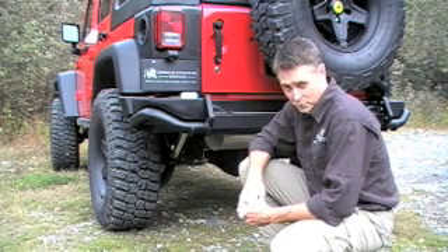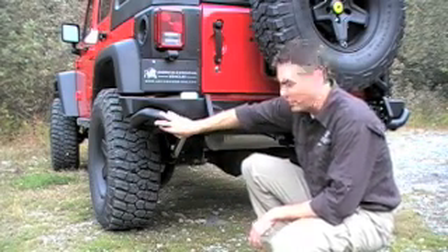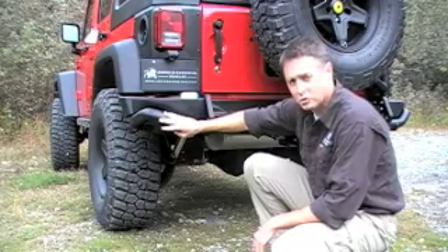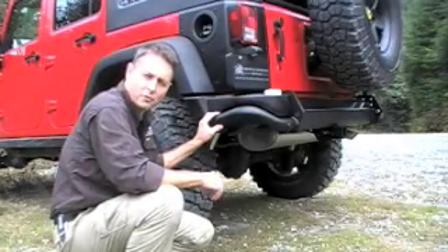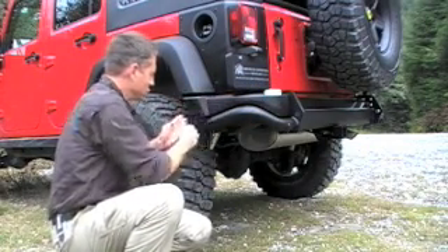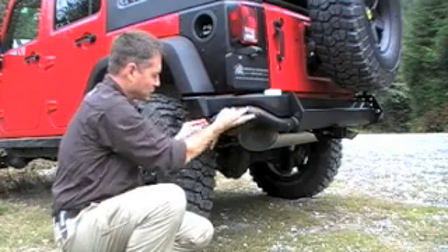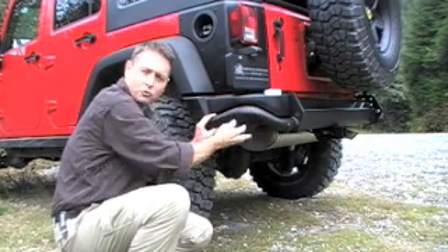Obviously, one of the most important jobs of any bumper is to protect the vehicle. This is particularly critical with four-wheel drive vehicles, where impacts of rocks can often come up right from beneath and cause all kinds of damage to sheet metal. To build the right amount of protection, AEV has used very heavy materials in all the right areas. A lot of aftermarket bumpers attach to the chassis, come out around the corner of the vehicle, and terminate — they don't actually return back to the chassis behind the wheel well. The way AEV has approached it is with a heavy tube that attaches to the chassis, wraps around beneath the corner, and goes back and terminates at the chassis. This is the only way you're going to get adequate protection from big rocks on trails like the Rubicon.